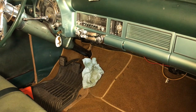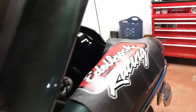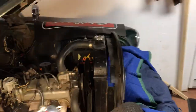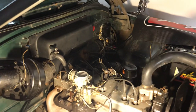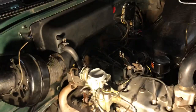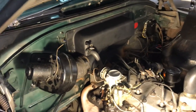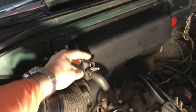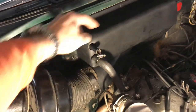I'm also working on the heater system. I pulled out the entire heater core and water control valve, and took the heater core to a rad shop and had them flush it out, clean it, and get all the scale out of it. I'm just about ready to finish up the job. The heater core is here — water coolant goes into the heater core and comes out the top, circulates through.